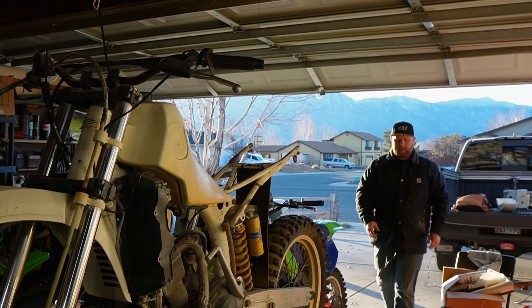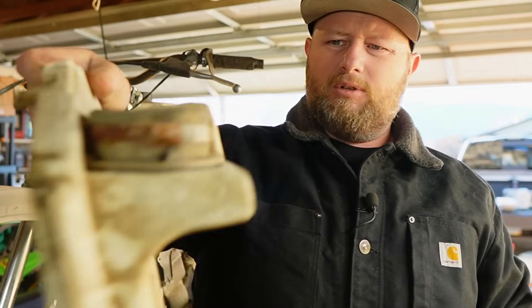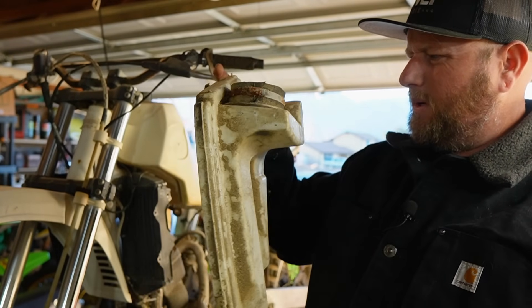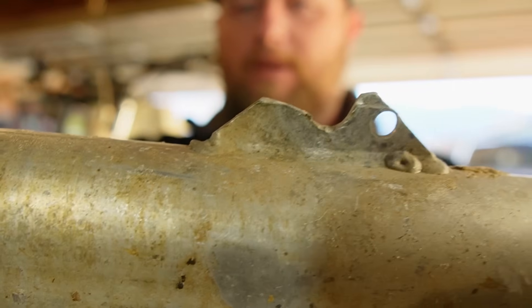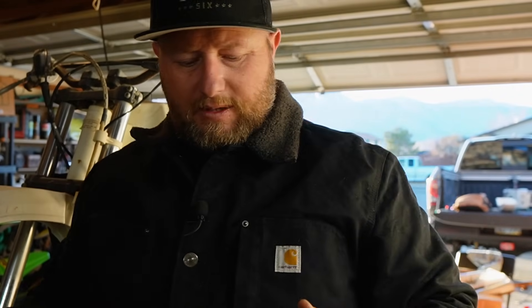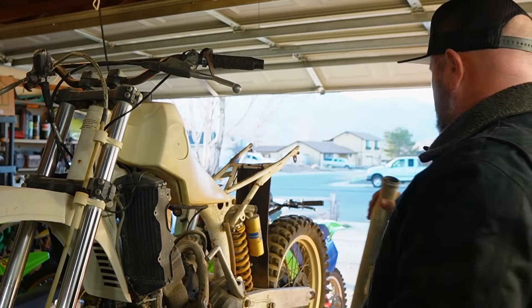A bike in a bucket — a bucket of a bike. We got two different air boxes; one's got a nice air box on it and the boot's been repaired, the other is completely rotted off and full of sand. Here's the muffler from the box — that's giant. Big, and then a snapped-off bracket. You can't see through it, plugged with probably sand. And how many sheet metal screws do you need to hold in the spark arrestor? All of them. So that can needs to be restored, gutted and repacked.